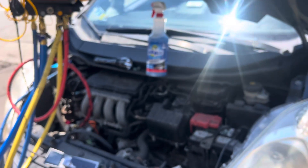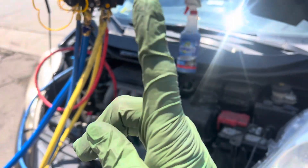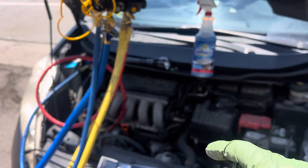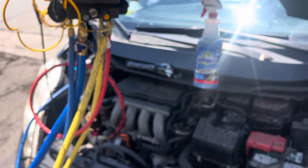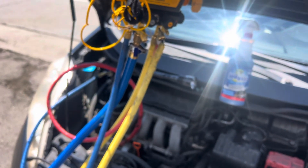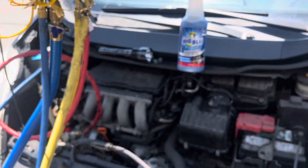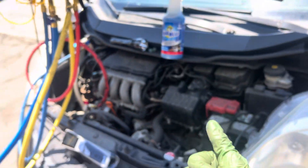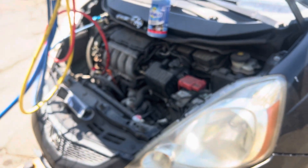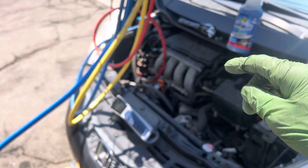I didn't find anything under the dash. I'm going to put some UV dye in it, but UV dye won't find a leak right now because it's not that big — that's just for later diagnosis months or weeks down the road. I already went around under static pressure of 67 psi and that didn't work. We're going to do high-pressure nitrogen, ultrasonic testing, and use some bubbles to go to gambit and see if the leak is obvious.